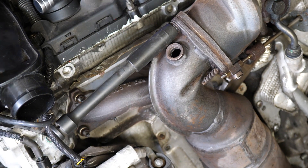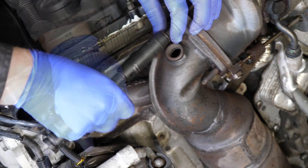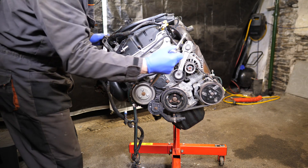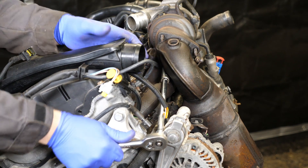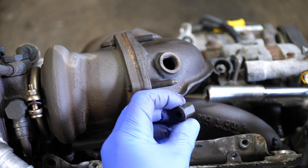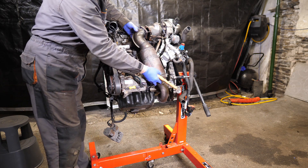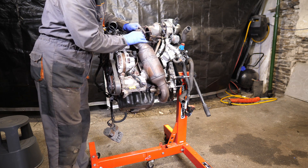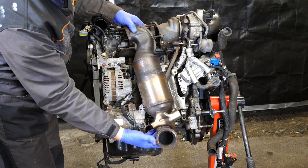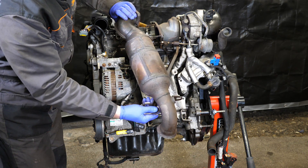Get these three top nuts out — one is in an awkward position right underneath, and you might need a slimmer socket to reach inside for the third one. Thankfully none were seized — perhaps somebody has already had this catalytic converter off before. Give it a very gentle tap to free it — don't bang the catalytic converter in case you crack it. There it is. There are three names on it: Peugeot, Citroën and BMW — so this engine is used in all three vehicles, and I think also the Mini.